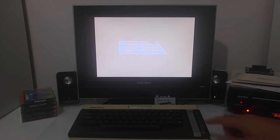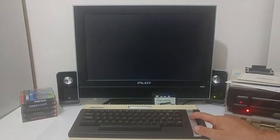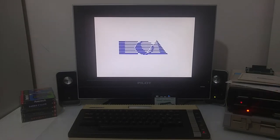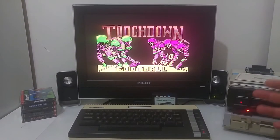This drive is the Mega Speedy drive and it was set to a custom ROM. Some protected disks do not like those custom ROMs when they boot, so I'm going to switch to the standard ROM of the drive. This is a very important tip: if you have a floppy protected not just with a simple bad sector but with a special custom track, some upgrades like the Happy or the Duplicator will not allow you to load this disk and you have to use special software like Slow Mode Tool to convert the drive to standard speed.